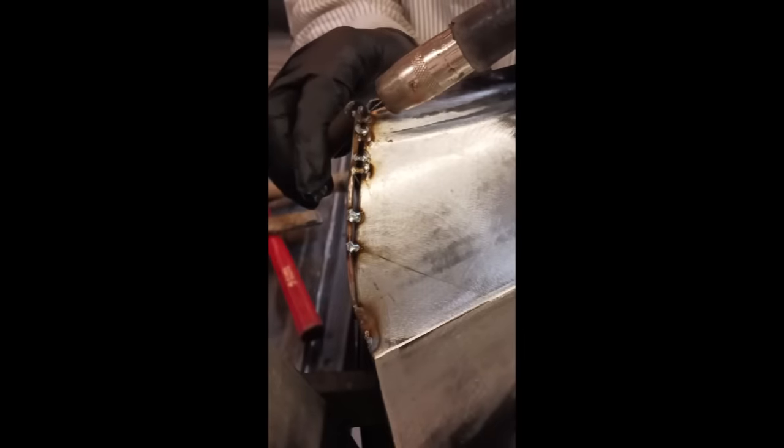We're building that little edge, ramping it in there. We don't want a hard break because we don't really want to use body filler here — we want this to be a metal finish. One very important thing: you want to make sure that it is lined up. You don't want it really high or low. I've got a little brass rod that I'm using as a backer so the weld penetrates through and I get a really nice weld, not a lot of voids. Being level is really critical, because if it's too high or too low, you've got to grind too much off, or if it's too low you have to add filler.